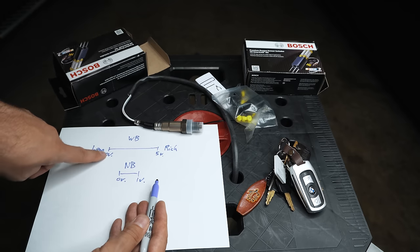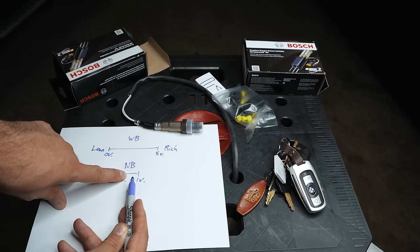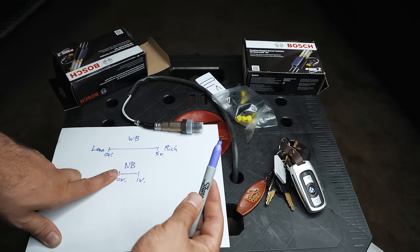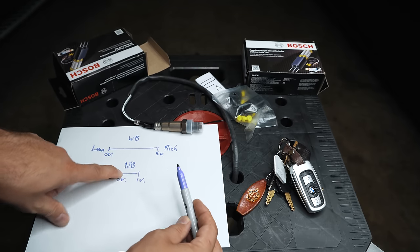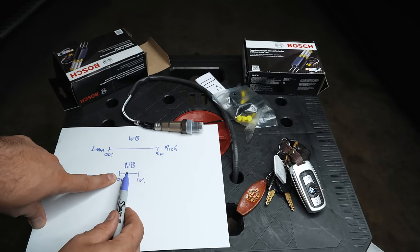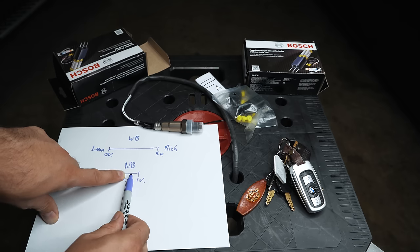When I flashed my new MSD81 ECU, it immediately referenced the narrow-band sensor for stoichiometric, detected something was off, and flagged it. If you've ever had a misfire after a warm restart — runs rough, then the ECU smooths out, RPMs go high, something feels off, and next start you get a check engine light — that's because it had to go open-loop, disregarding the sensor and making an educated guess. That's what happened to me, but I had been running on that bad narrow-band sensor in my MSD80 for months, and it was actively reporting that everything was fine while giving the wrong reading.